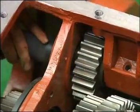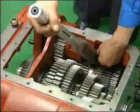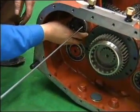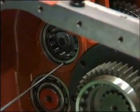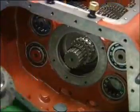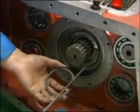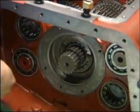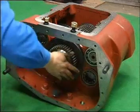Knock the reverse countershaft slightly with the copper stick, add washer and use self-locking nut to tighten it. Knock bearing 2307E into the transmission housing with the copper stick with the marked face outside. Dismantle the locating drive gear assembly. Move the reverse gear of the mainshaft to the back and let the two reverse counter gears mesh with each other. Insert 14750 stop ring into the groove on the reverse gear mainshaft, install the drive gear so the inner spline of the drive gear meshes with the outer spline of the mainshaft, then knock the driving gear.